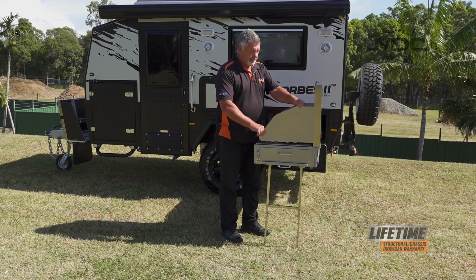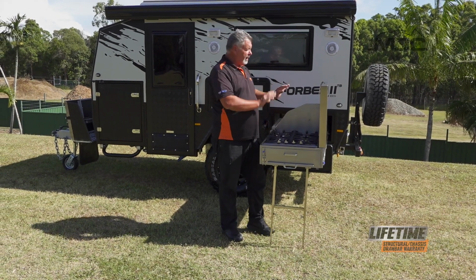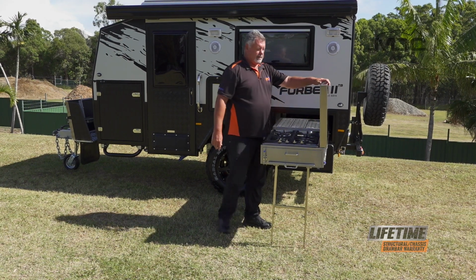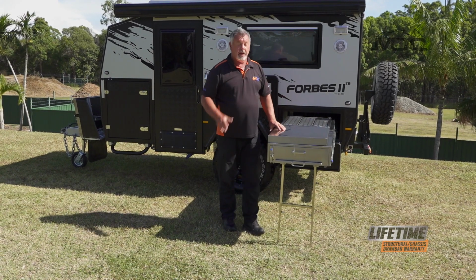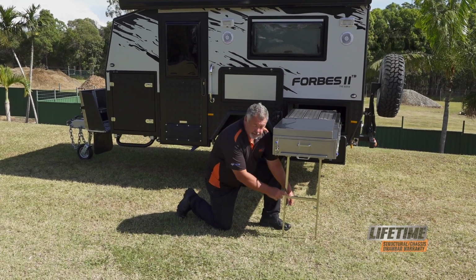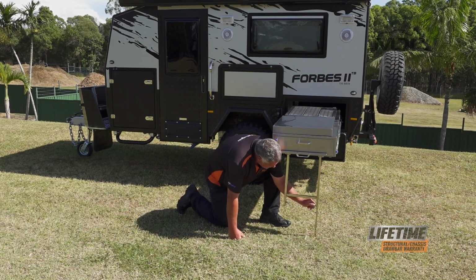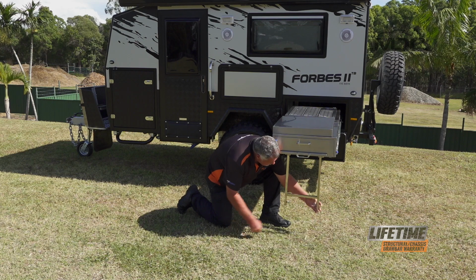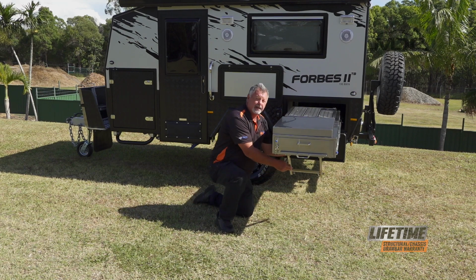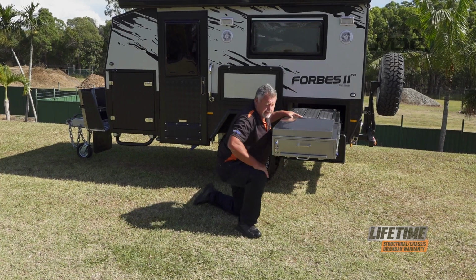When packing up the cooktop, raise the wing panels up, move them both into the back of the lid. Now we can close it. All you need to do now is raise the leg. To do that, undo the screws, and put it back into position underneath the kitchen. Pull the little spring-loaded pad bolt back, release it, and that'll lock it up out of the way.